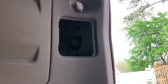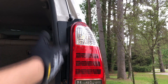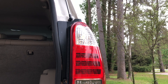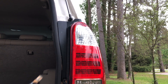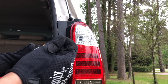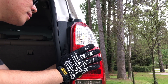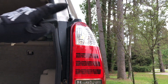And that's all there is to it. One thing to keep in mind is that these LED bulbs are polarity specific, meaning they only work in one specific direction in the socket. I hit unlock and it did not flash — that's not a huge deal. All we need to do is go back in, pull the cap out, take the bulb and flip it 180 degrees, and now it should work. Put it back in and hit unlock — there we go, now it works.